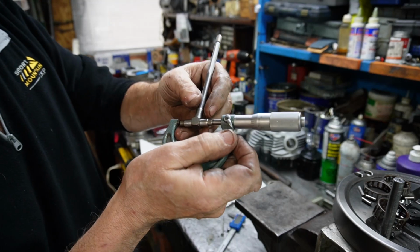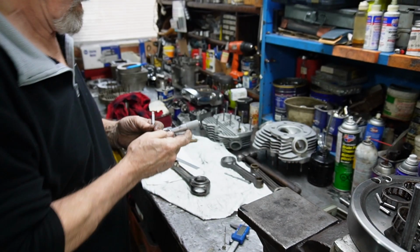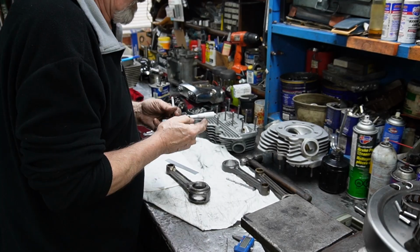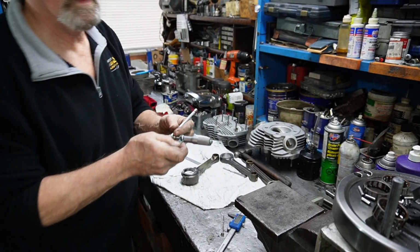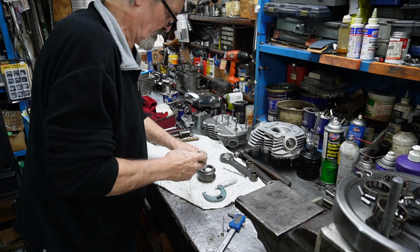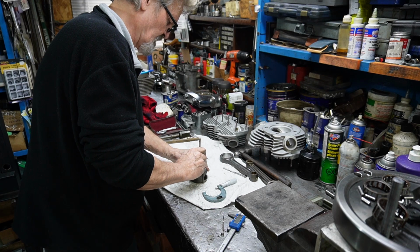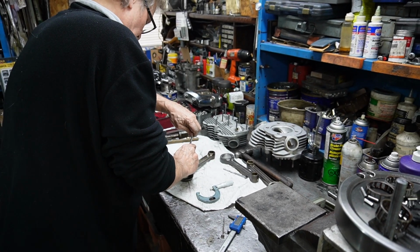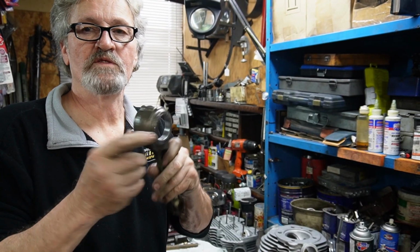And that's what we're looking for to get it right on that zero mark, is 625. That's what we've been shooting for here, and it was undersized under the other side. Okay, top to bottom, other way, top to bottom, same thing. Flip it and make sure we're straight on this side as well. Should be, because the whole rod was put on there. 0, 0. And we'll check it top to bottom as well. 0, 0. So now we know that the bottom of this rod is concentric all the way around.